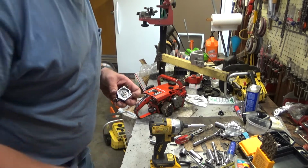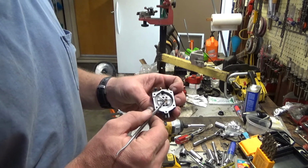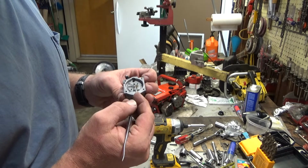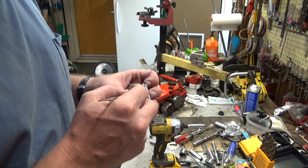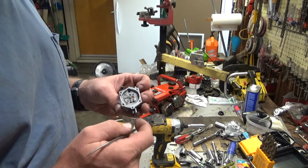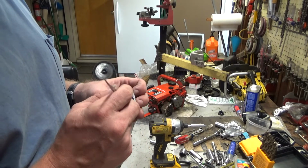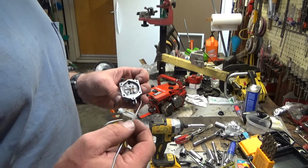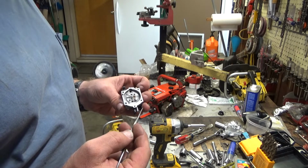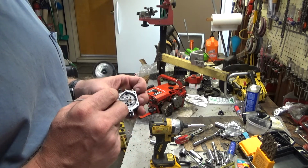The other was this check valve that's under here, and trying to service this without destroying something is almost impossible. Getting that snap ring out without puncturing the screen is difficult, and typically in the process that damages the little piece of diaphragm material underneath there that acts as a check valve. Erratic, improper revving, inability to adjust the carb, you've done everything else, it's probably that check valve.